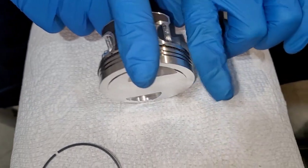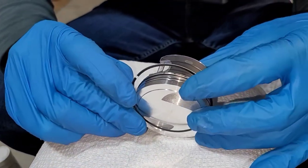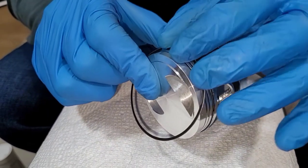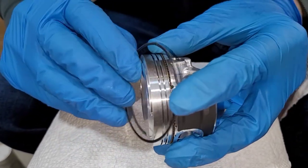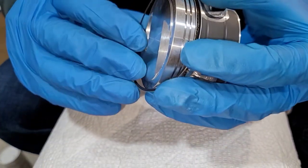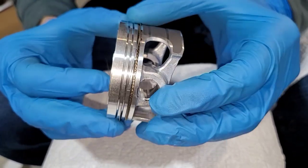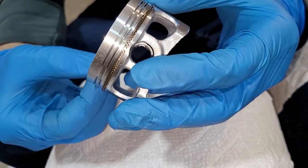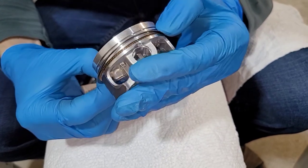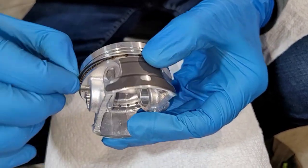Here's your slot, here's the first gap in the side ring, and your second gap should be over here, so I'm going to go ahead and do that next — this time hopefully getting it on the correct side of the oil ring. It's a little bit fiddly. You kind of just work it all the way around. It sometimes wants to get hung up and doesn't want to sit underneath, but we're getting it.